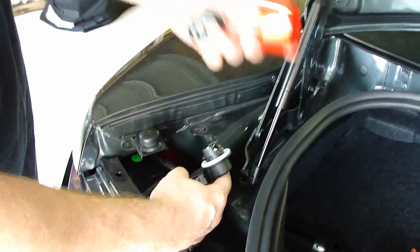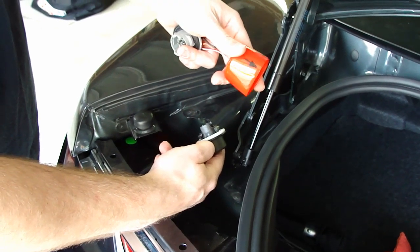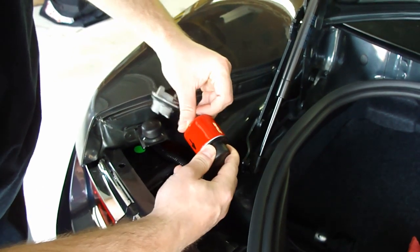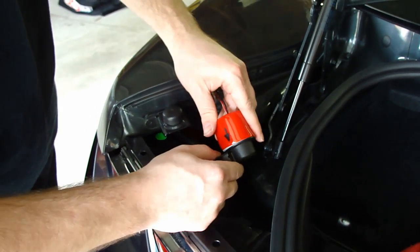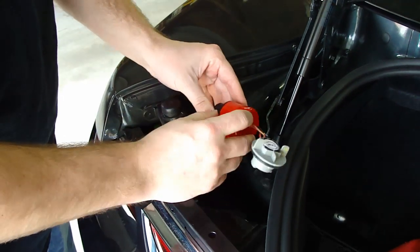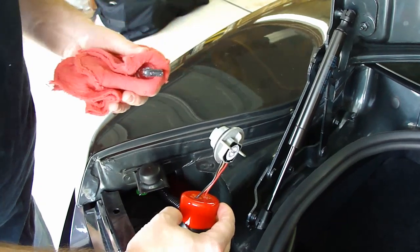Now here's the part where we assemble the harness, and it's pretty simple. Keep an eye on the ground wire that we marked with the zip tie, and the black arrow that comes on the weather-resistant cup here. We want to insert the two together, just like you would the bulb, with the arrow on the side of the ground wire — and it just kind of pops into place. You want to make sure that the seal of this red cup goes all the way around. If you really want to take some extra time, put some electrical tape around it just to make sure it creates a good seal. The electrical tape is optional — it doesn't even say to do it in the instructions, but I did it for good measure.